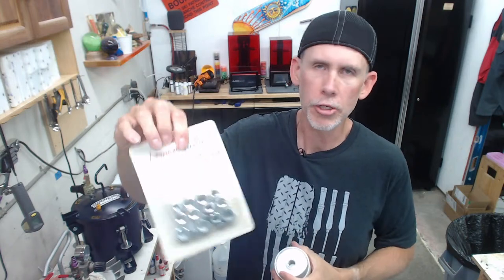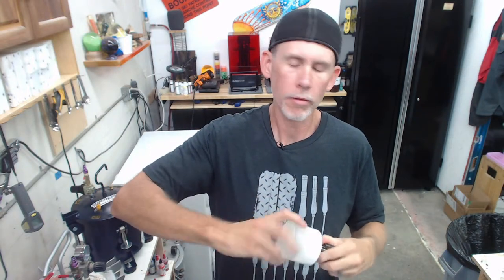You can buy a kit that adapts to a couple different sizes — they have standard half-inch, inch, and other standard sizes, plus metric sizes. The problem is you can't just buy, say, a quarter-28 thread on its own — you have to buy the whole pack, which is kind of expensive. But once you have your size, you basically put that on your shifter and use these universals. All these different sizes have the same outside thread, and the inside is what you screw down onto the gearshift knob. I've linked to the hardware and the mandrel down below.